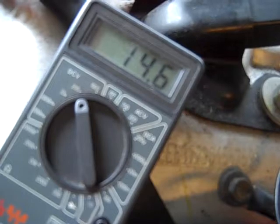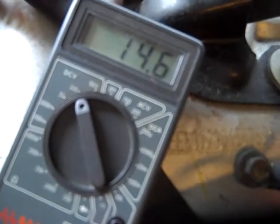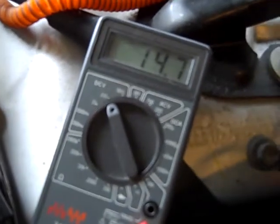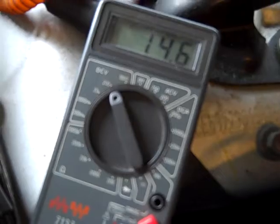What I normally do if I'm having an electrical problem is I'll connect my meter to a good ground, I'll have the engine running to make sure that all the fuses are hot, and then I'll go ahead and probe with the positive lead and just glance back at my meter. Right now the engine is running so we're reading battery voltage plus whatever the alternator is putting out — the alternator is working pretty hard right now, about 14.7 would be maximum.